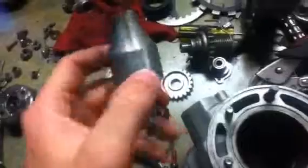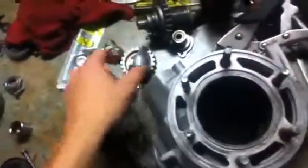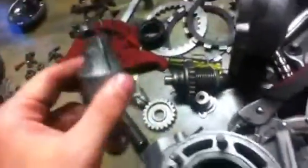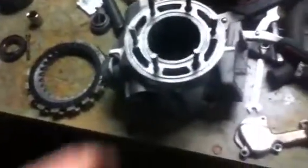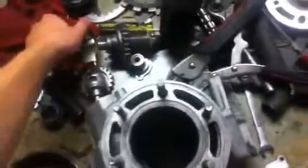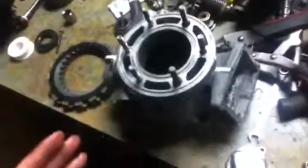And then that mysterious bike that keeps blowing up on you — that has an overbore and has scuff marks on the side of the piston at the same exact spot — well, maybe now you just figured out the problem: you didn't modify the power valve. Or if you found out that you needed to mod the power valve but didn't know how, well it's basically that simple. For this YZ250, that's how simple it is. Most other bikes are usually that simple too because they all work the same, though the designs may be slightly different. That's the basics on power valves and why to grind them down before you do an overbore, because you will screw up your motor if you don't.